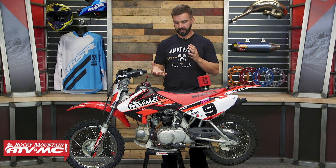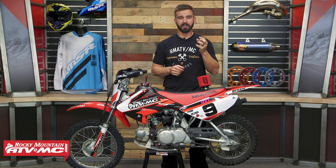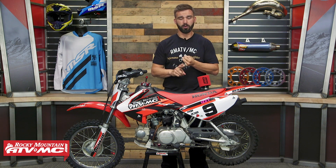Now we've covered sizing. Let's give you some tips and tricks, some things to watch out for to help get the most out of these bikes. First thing is with the carburetor. With any of these smaller bikes, carburetors are always something to look out for. If you're going to let these sit for a longer period of time, the jets are really small. So it's really important that if it's going to sit for two or three months, you either want to use a fuel stabilizer or drain out all the fuel — that way you're not cleaning out gummed jets. Also these smaller bikes are jetted pretty lean, which makes them cold-blooded. In colder weather it can be more difficult to start and takes a long time to warm up. To combat that we went from a 38 up to a 40 on the pilot jet.